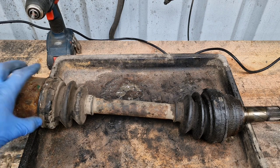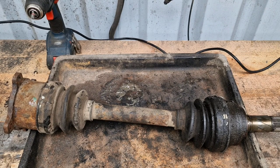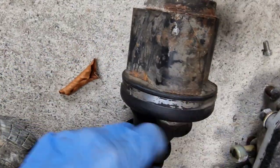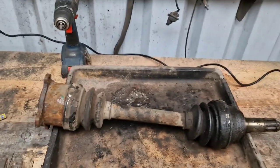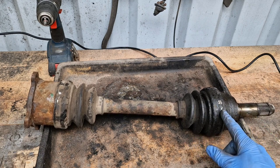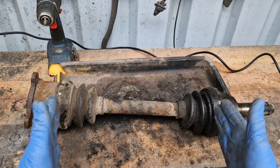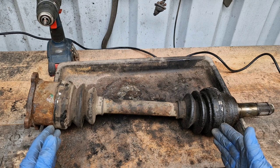This is one of the new drive shafts — off the Z31. It didn't say turbo on the ad but I think the turbo ones have the inbuilt CV. You'll notice the boot here is just circular, whereas the ones that came with the car have this tripod indent — those are apparently the weaker ones. I went to start with those but quickly learned that wasn't the way to go. These secondhand ones are legit — you don't have the tripod setup. The boots are already a little leaky so I'll take them off and disassemble. One key thing I need to do is invert the mechanism in here — that'll actually shorten the shaft length just enough so it doesn't bind when you lower the suspension.